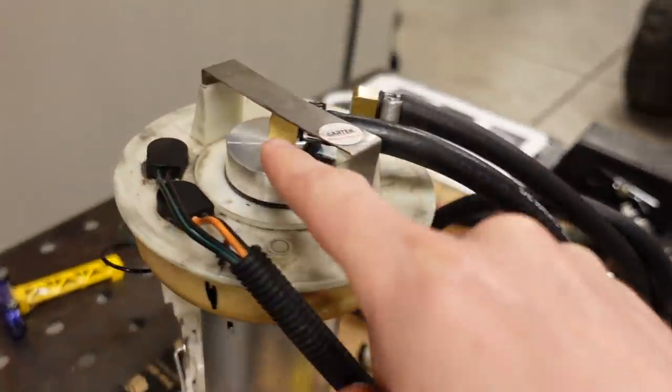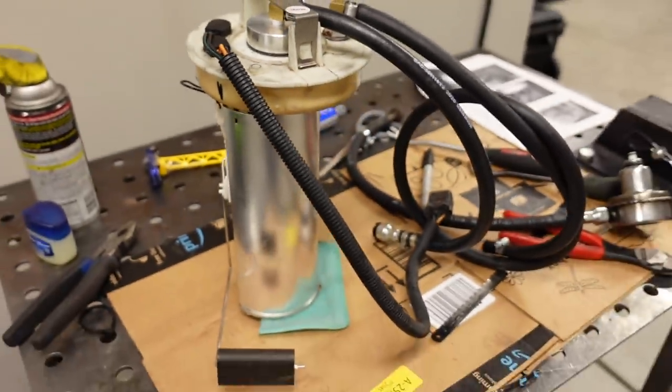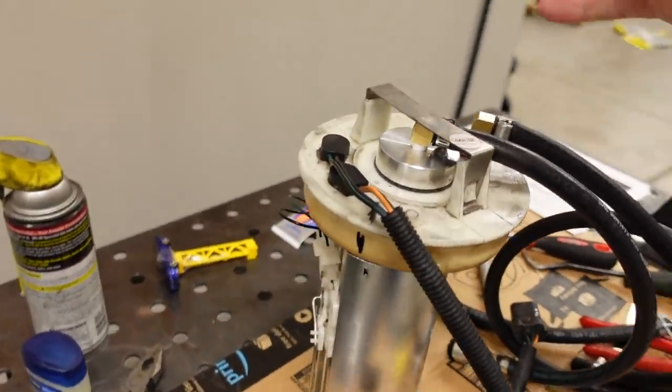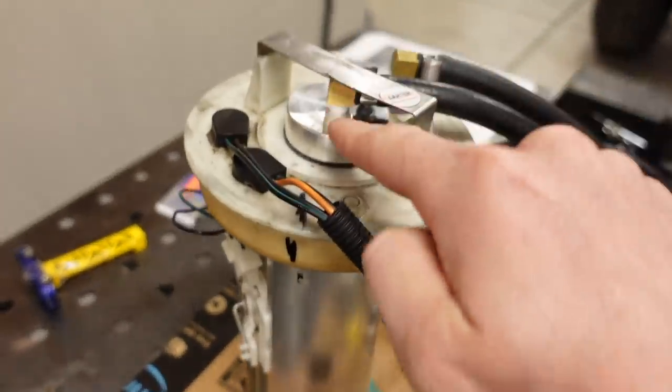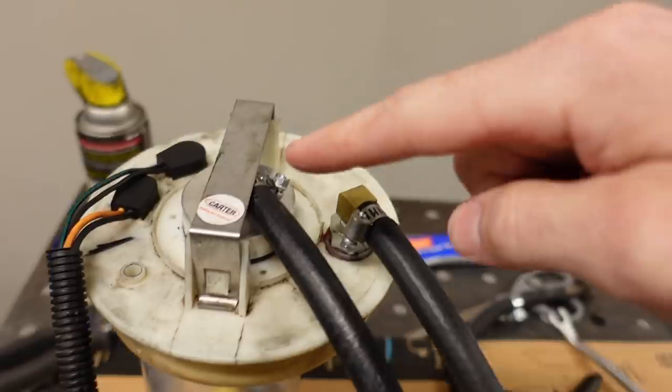ultimately. On the fuel pump side, we have to get rid of that regulator because that's too low of a pressure, but you can't just gut the thing because it'll just allow all the fuel to bypass into the tank. But Novak does luckily sell this billet aluminum adapter, which more or less is a simple conversion. All you do is you pop the top off of here, there's this little clip, pop the old regulator out, there's two O-rings, jam the new one in there, and that is your supply side.